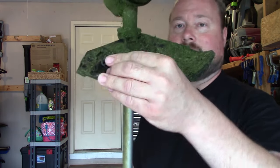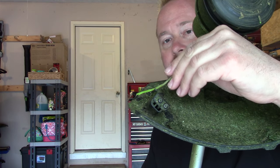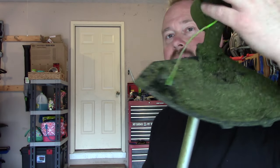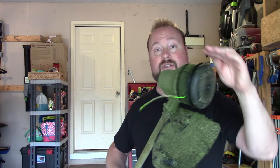You might be wondering how long to make the string. The guard right here has a little cutter, so when you pop it out and do the bumps, it'll whack a few times and then cut off the little excess. That length is predetermined for this string trimmer — it knows how much power it's got and what string size you're probably putting in, so they figured this was the proper length to maximize the speed and power for this unit.